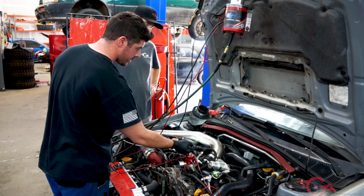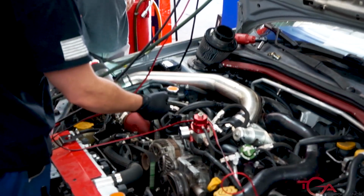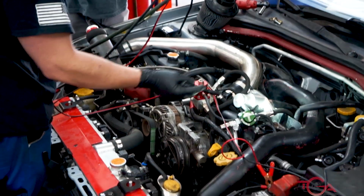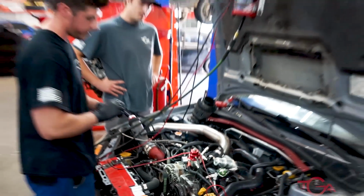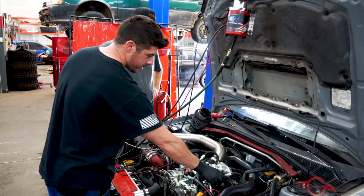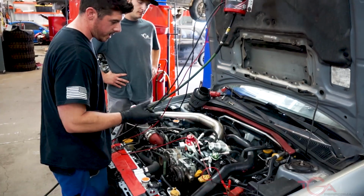More smoke, there's a lot of leaks. So this is negative. We do not like seeing this on our Pre Dyno. This will fail you, and you'll need to fix all these things in order for you to have a good tune. Other things to look for too, stuff like this is not secure, this sucks. We don't like that. Things like that where they're just rattling around, shaking, those can all affect the tune and they're just unsafe.